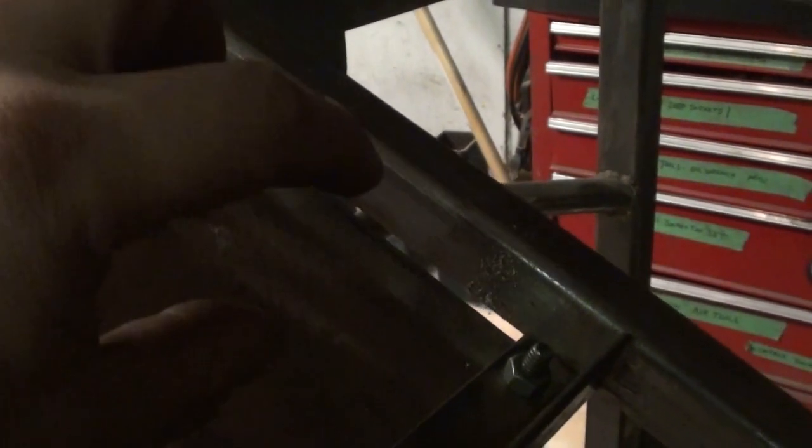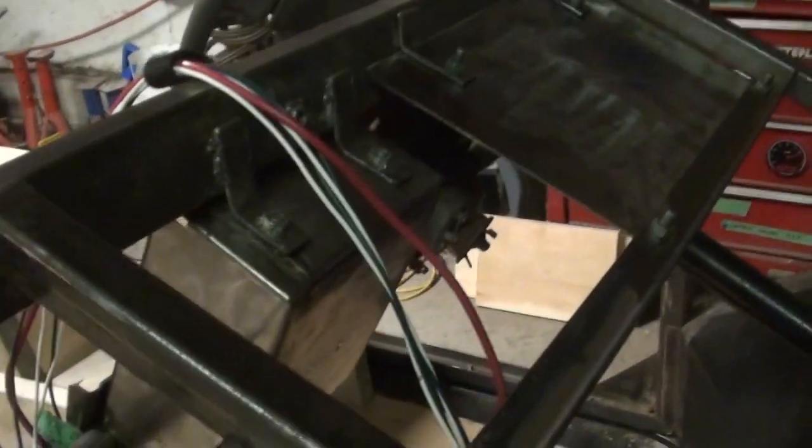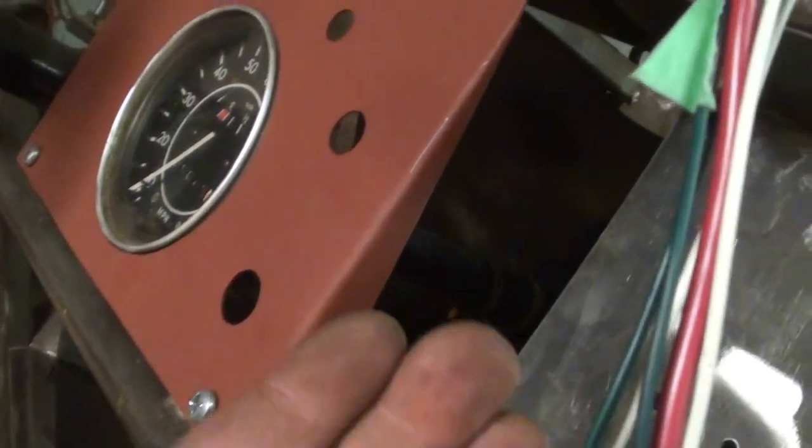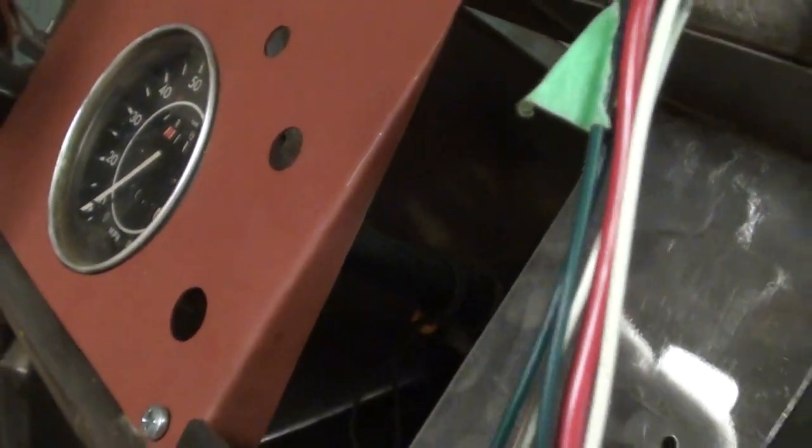And you can see there's just a void here, about a 1-inch gap, and that void will be between the hood, the exterior sheet metal, and it'll give you just enough clearance to have self-tapping screws through this sheet metal that will mount all the components on the underside. And then you'll be able to access that stuff by either removing the instrument panel or just reaching up underneath. You'll be able to get to the stuff if you have to do maintenance.